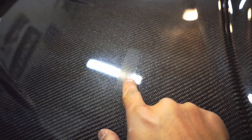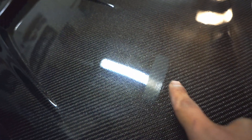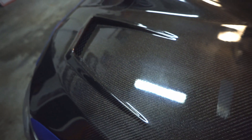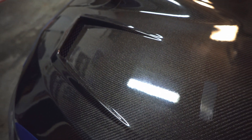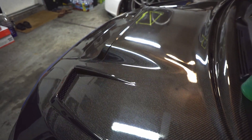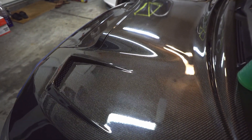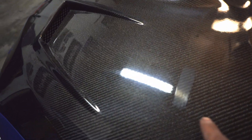This is where I wet sanded it slightly. If you look, there's a bunch of highs and low spots — that's what's creating this fuzzy, holographic finish. He did tell me this was ceramic coated, and personally I would have shot the hood fresh with clear, because that entire process consists of wet sanding the entire hood smooth, shooting clear over it, and after the clear coat cures, the painter would wet sand it down, buff it, cut it, and polish it.